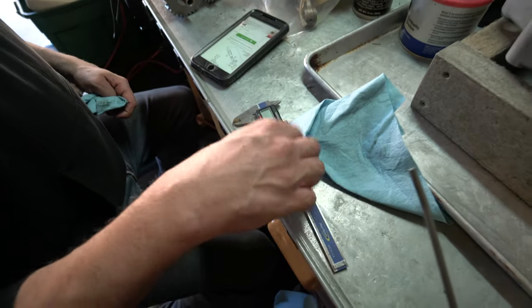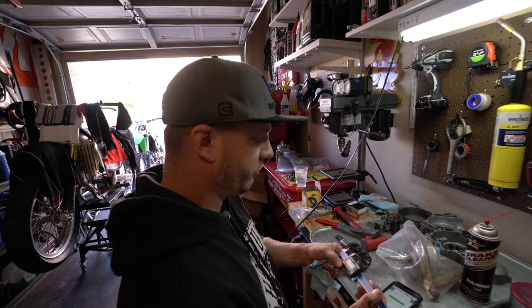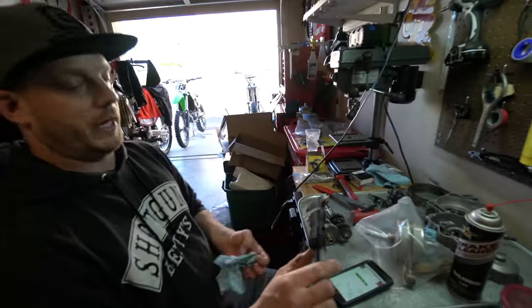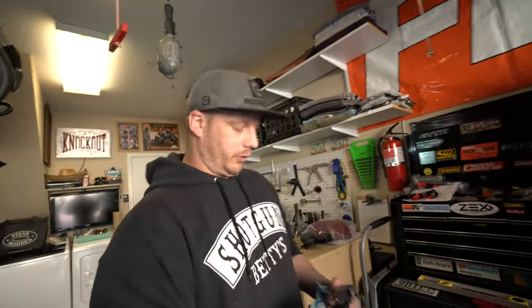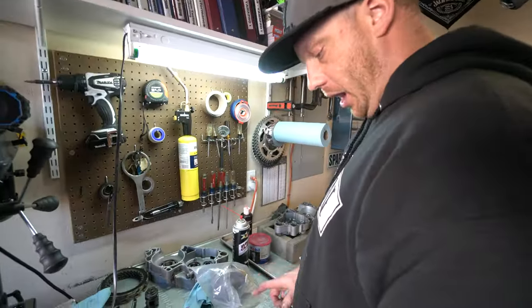Where do you buy one of these calipers? Everyone can use one. This is just a standard caliper — just a Blue Point. I got it from school when I graduated. You can find them on Amazon or eBay. I call them vernier calipers — they're not super accurate but they get you close enough to measure. These are super handy: say I need a socket real quick, I can measure and know boom, it's a 22 millimeter. Especially when measuring shims — this one's got 40 thousandths on this side and 60 thou on the adjacent side. You want to make sure they're in the right spot. If you're going to try to eyeball that, you'll never know.